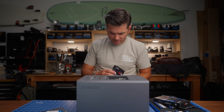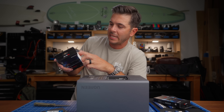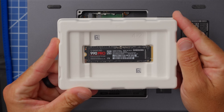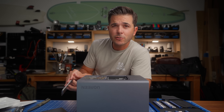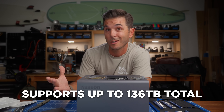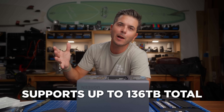If you haven't gotten a NAS, check out my first video on this — I knew nothing about NAS devices and it's been simple and easy to set up. The software is killer and I've been using the phone app a ton. I'm also not paying for so much cloud storage anymore — cloud storage costs are crazy. Right now I've got four 4TB hard drives in here, using one for redundancy. The third upgrade I want to do is put in four 20TB drives — with RAID 5 that's 60 terabytes. Try getting 60 terabytes on Google Drive or Dropbox: it's hundreds of dollars a month.